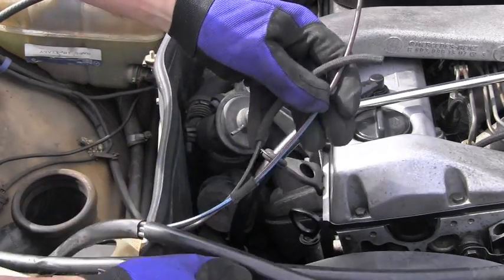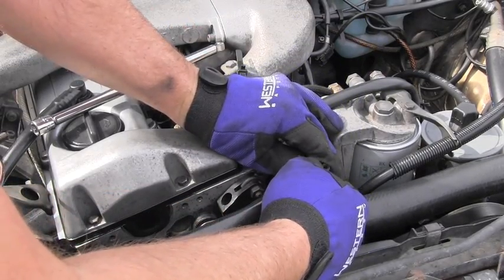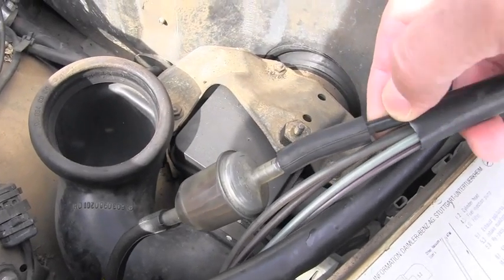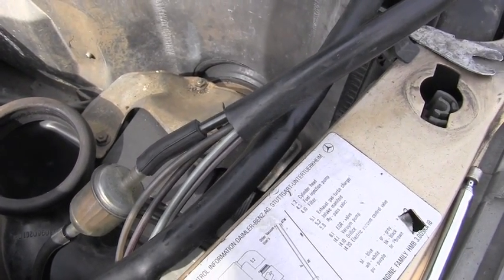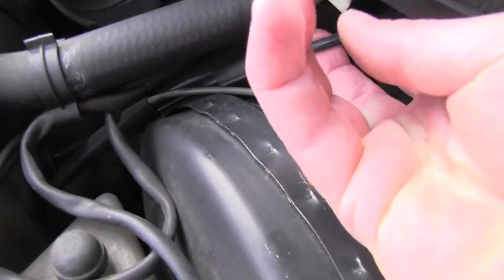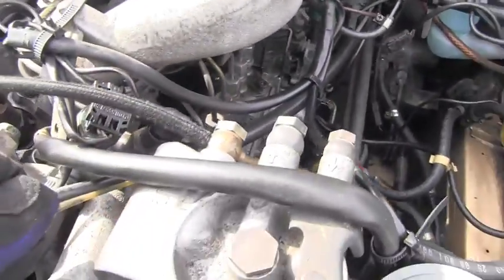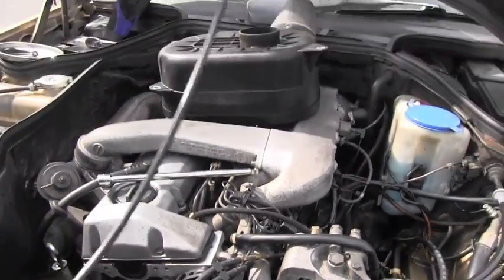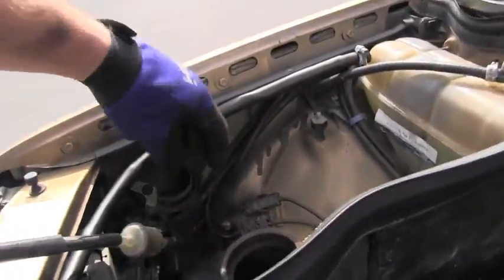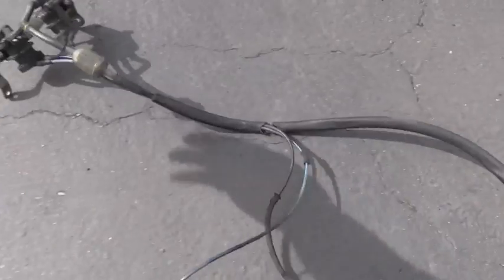So these two lines are free. Now I can finally unhook these lines — one, two — and there is one more line, the hose which is the thickest one. It's black in color and this one is the ventilation to the passenger compartment. If you trace it, it goes all the way here, through here, and all the way right here, and this is where I'm going to disconnect it right now. After doing so, I can carefully start pulling the ventilation line out of all the other lines. You can see it suddenly free, and here you go. We can place all of this here on the ground.